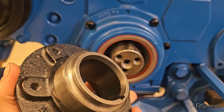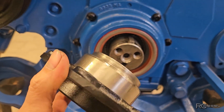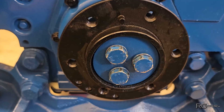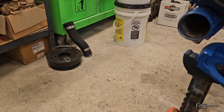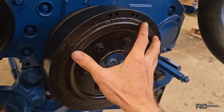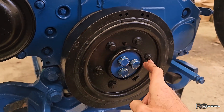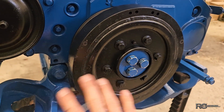Got the oil pump torqued up at 18 foot-pounds, new seal in there. I've got a new sleeve on this hub for the front and a little bit of oil on there, so now I can press that back into place. Got that hub pressed back on with the new seal, new retainer, new wear sleeve. Now I've got to put that dampener pulley back on - 40 foot-pounds on those bolts. This dampener is actually keyed to that hub with a pin right there, so it only fits one way, and that's what times it to the crank. Used a little Loctite - it's pinned and timed. So that's done.